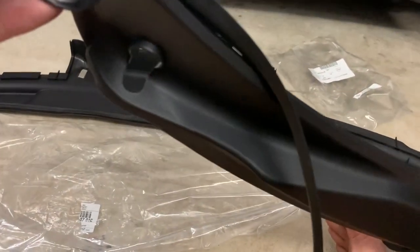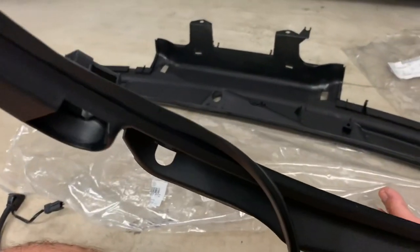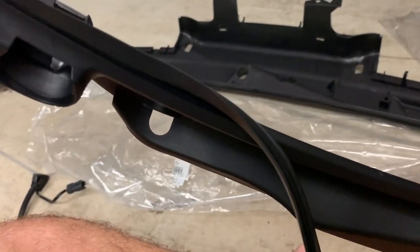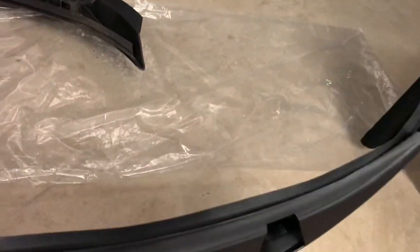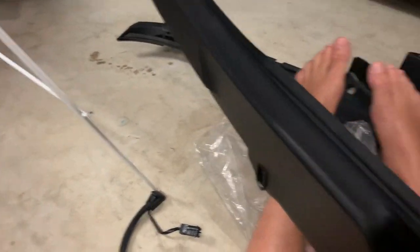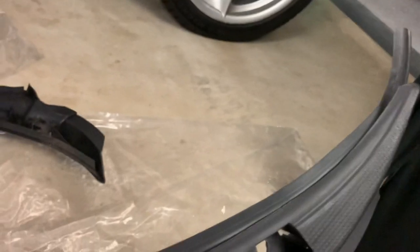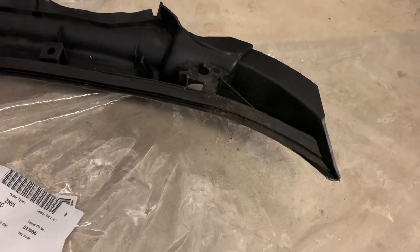Now it's time to fit the rubber strip. There's a groove in the strip and a groove in the cowling - have a look at how your car was originally and it fits in pretty straightforwardly. They just fit together and hold themselves in place, so just take your time and get it all in nice and straight. You'll probably have to go over it a few times to get out any wrinkles because it's been packed up. It took a bit of fiddling and poking to get the rubber into the channel but it's in there. You could use a few dabs of super glue to help hold it. It's a little bit longer than needed so just trim it - look at how the old one was trimmed, they cut it on an angle to fit neatly inside the tip. Do that with some sharp scissors.